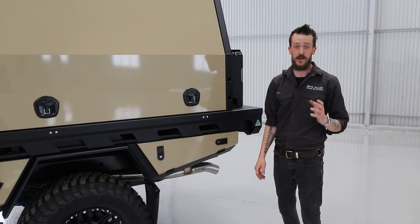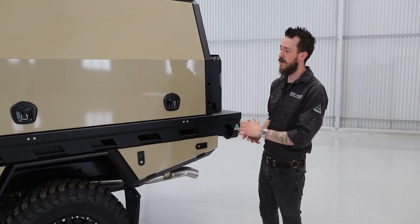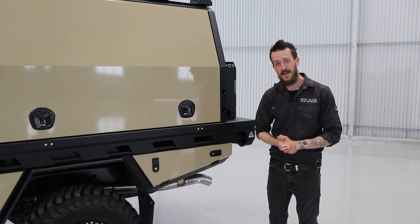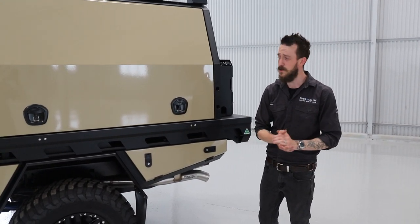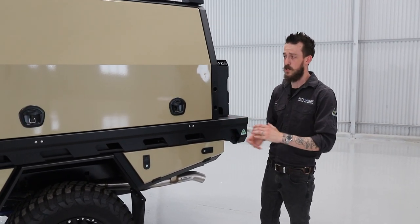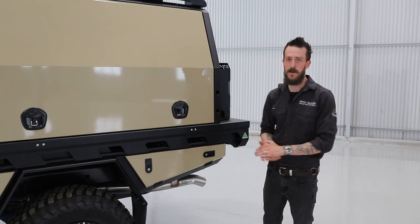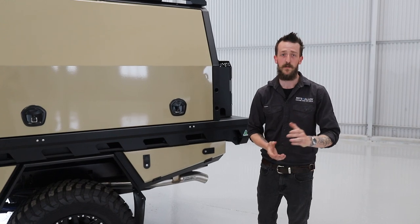To answer a really common question we get about setups like this — what do they weigh? In this scenario, given it's a 2050mm tray, 1700mm canopy, full internal fit-out and the selected exterior accessories, this setup comes in just under 600kg — so 590kg. But remember, you've still got to add a 12-volt system, a rooftop tent, finish off your accessories, put fuel in, pack the family and go for a drive. You've still done the GVM upgrade, so you're going to have a few kilos left over — but it highlights the importance of doing things properly pre-rego.